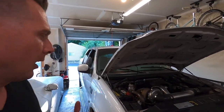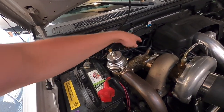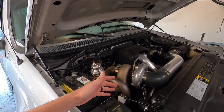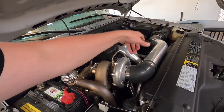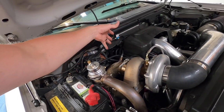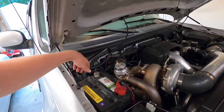If you missed the last upload, we've been messing around a little bit with moving the vacuum line around for my boost actuated cutout for the exhaust. So, brief overview: we used to have the cutout attached to the intake manifold, thinking maybe it's not opening as quickly as it should because we have to pressurize the whole intercooler piping and the charge pipe and the intake manifold